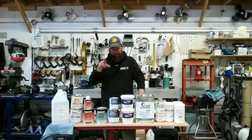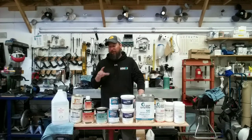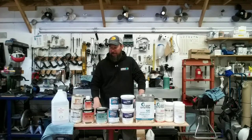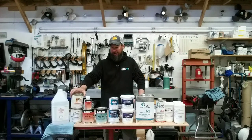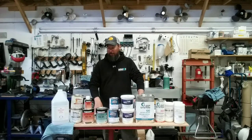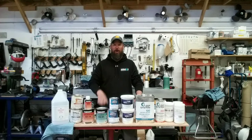In the videos you saw that I cut out the damaged area and assessed it as needed. The first lay-up we did was with G-Flex from West System — a two-part epoxy adhesive that forms a waterproof bond. It's called G-Flex because it cures 100% but remains somewhat flexible or pliable. You can still sand it and work with it. Boats are constantly under flex and load, so you want something that moves a little bit.